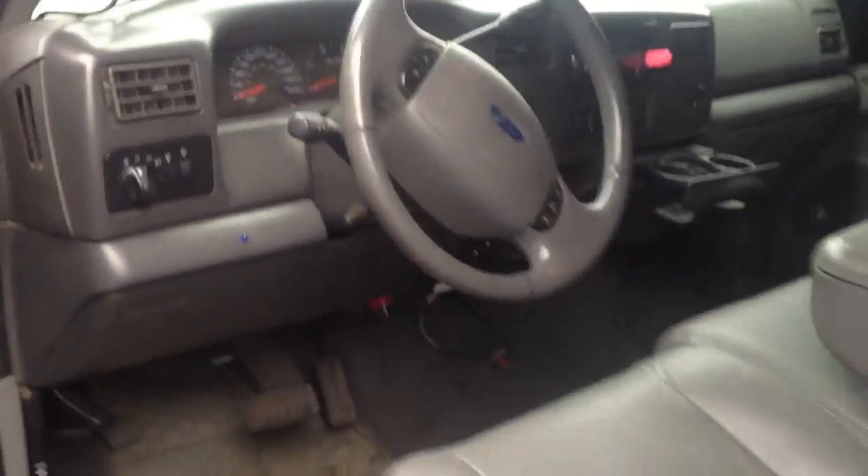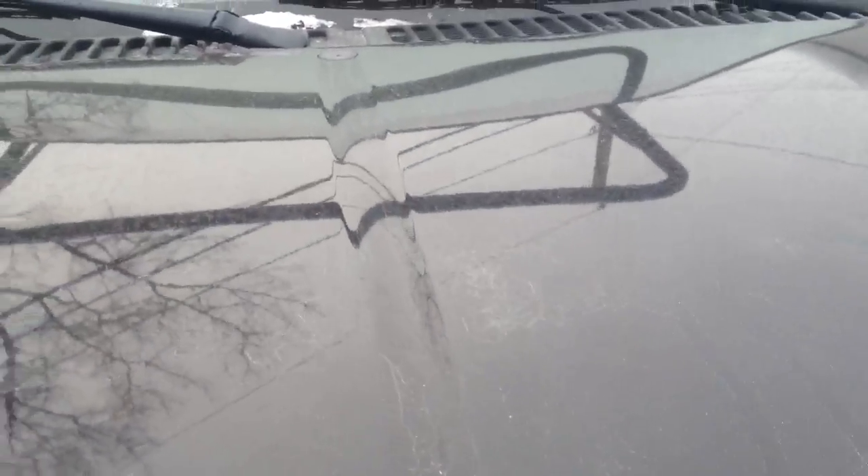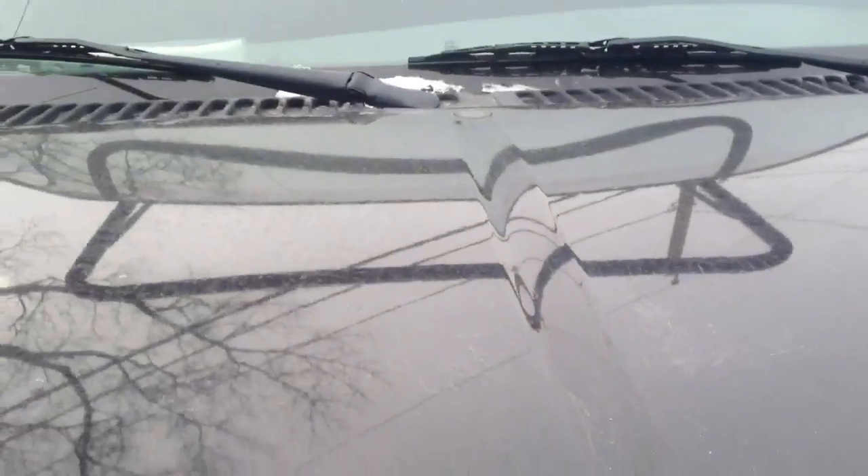It's got the Banks system — I'd say skip it, don't buy it. You're better off getting the SCT so you can turn off the EGR function. This one has the EGR delete in it, and since I've done that, my oil stays cleaner much longer.